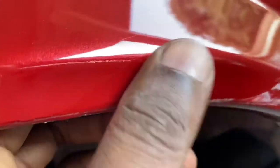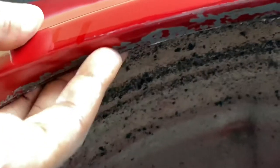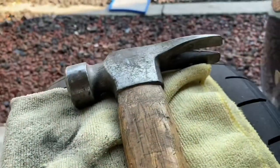About five minutes have passed. As you can see I marked it right here to let me know where to hammer, and it is folded all the way up. I'm not gonna go too crazy, but I just wanted it folded up enough to where if it does touch the tire, it's just rubbing lightly and won't be cutting on it. I'm putting the wheel back on now — all I'm using is a hammer, by the way, so that's why you see the paint chipping. I might give it a couple more whacks but hey, so far so good.